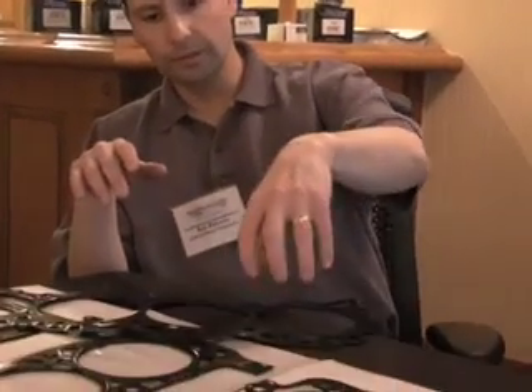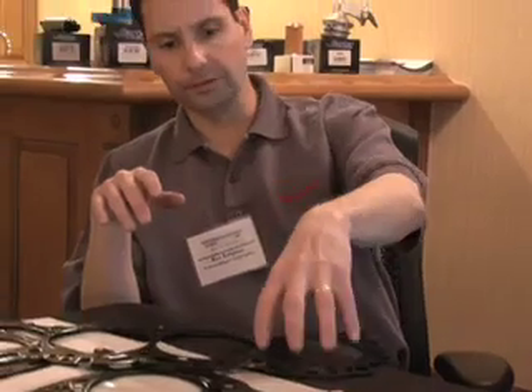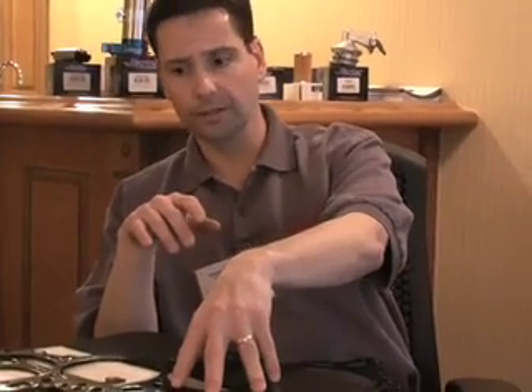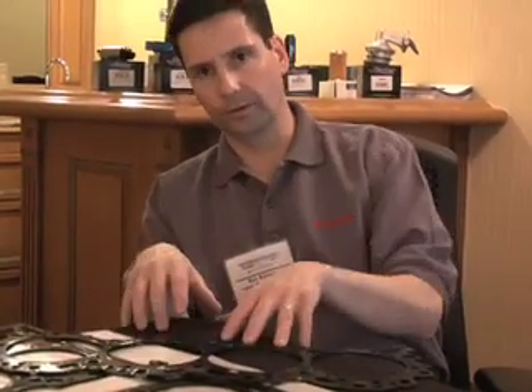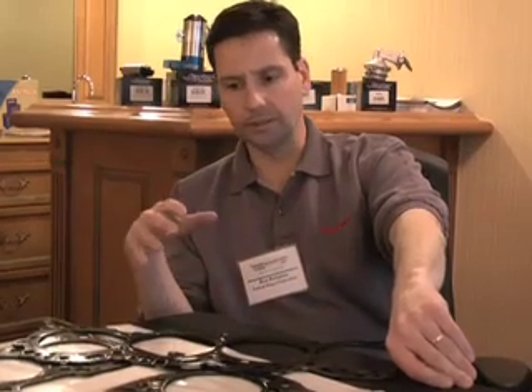The way we develop a gasket like this is by doing what's called the head lift test. Essentially, we pressurize the cylinder and then determine where on the surface it's lifting the most. Our engineers can then develop combustion seals and emboss beads that are going to move that bolt load around to seal the worst areas primarily, and then use whatever's left to seal the other areas where it's not quite as critical. That allows us some flexibility in terms of how we design the gasket for the given engine application.